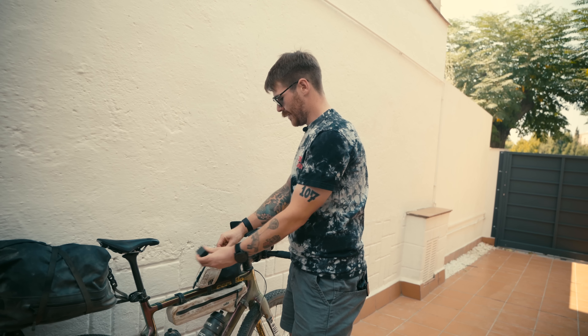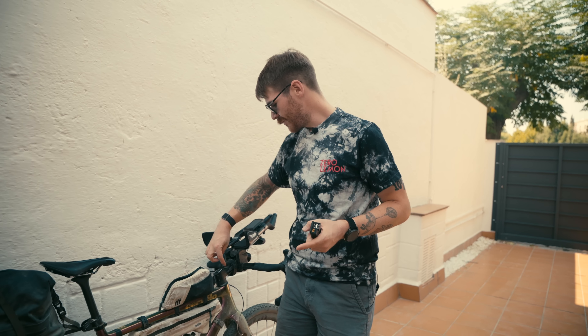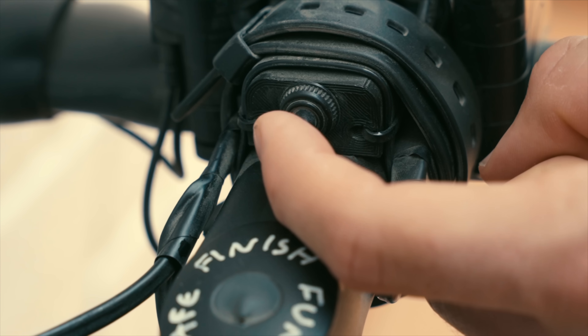Inside the top tube bag I was running a K-Light current regulator from the dynamo, which powers my lights and allows charging. The setup works by running a charging cable into the front light and then into the K-Light AC/DC unit. From there, you get two USBs — one powers the K-Light rear light, and the other runs into a battery pack which I subsequently charge from. This way I always have two USB outputs and the battery pack stays charged. The K-Light setup includes a little switch that lets you turn off the second USB to reduce dynamo resistance when not needed.